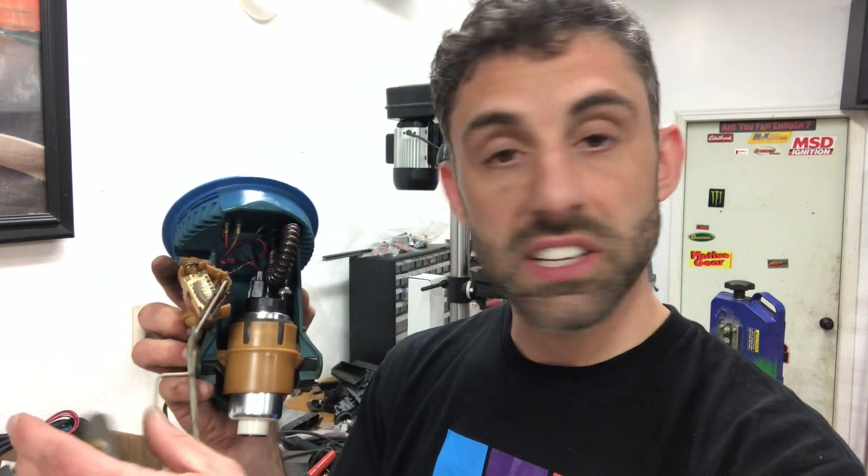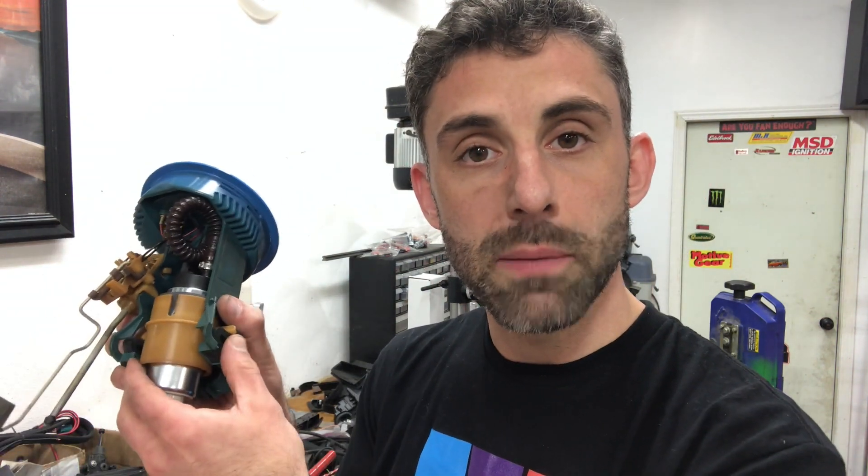Now that I've replaced the in-tank fuel pump with the Walbro LP255, I've put in a new Oetiker clamp. Oetiker clamps have really been the theme these last couple of weeks, but they are important. This is what was on here before, and this is what we're replacing it with. Fuel level sender is still intact, the absorbers are good — let's go ahead and put this thing back in the tank.